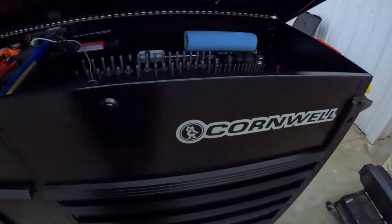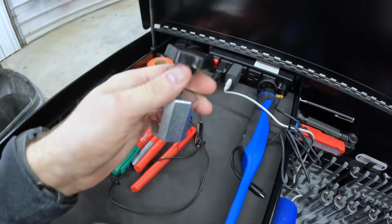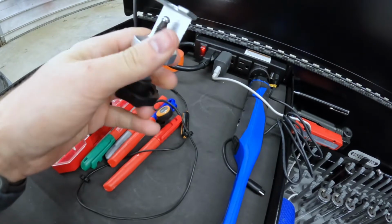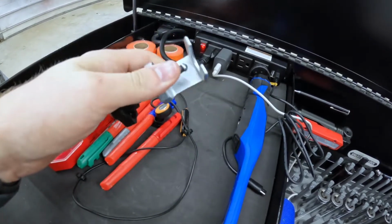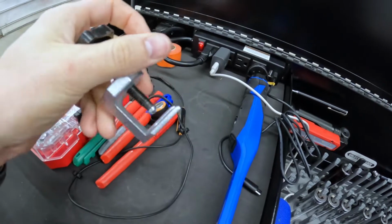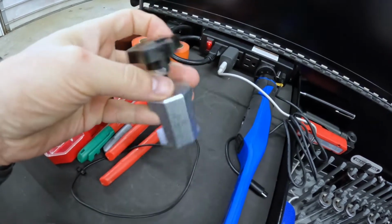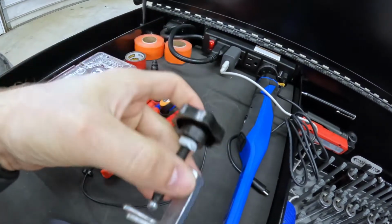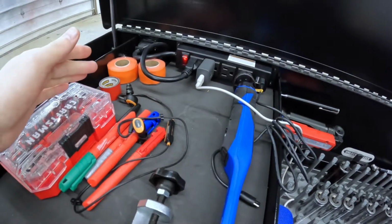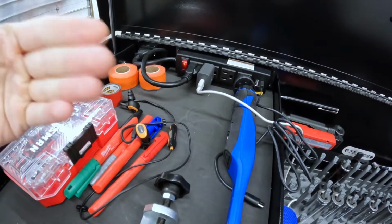Way better design. So up here, I got my extra Sharpies. This is an OTC wiper arm puller. A lot of times up here in Ohio, even if a car is only a year or two old, an SUV, the wiper arm will be just rusted on there, and you've got to get a 2 or 3 jaw puller, and it's a pain to sit there and try to hold the jaws on while you use the puller. This is going to work out a lot better. Way more simplistic design. And why I take some of the wiper arms off is it just makes it way easier to get your film in there. If you can pull that wiper arm off, you can lay your film on the back glass and you don't have to worry about that wiper arm.